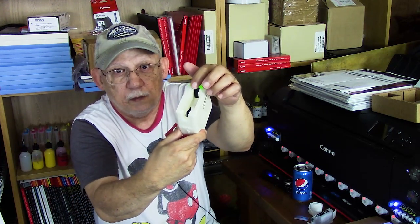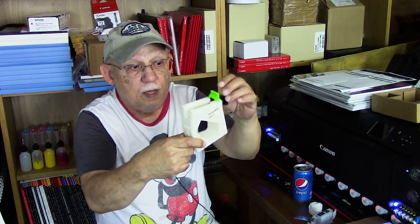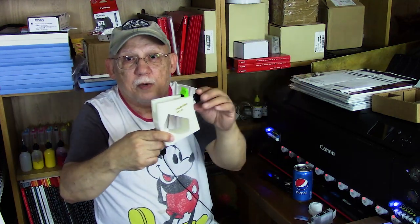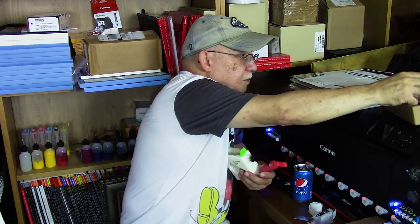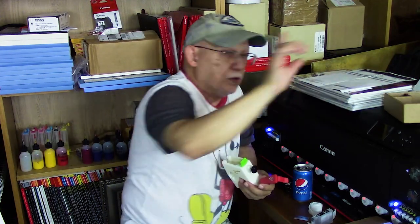Right here there's a piece of black rubber. This is what's going to seal against that vent, basically creating a completely sealed compartment. The cartridge will be sealed at the top, and then you will attach your syringe to the bottom. Now in order for this to even work - and this is what we were doing way back - you have to have a syringe, because these cartridges hold a total of about 14ml of ink, 14 to 15.